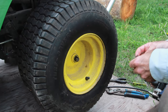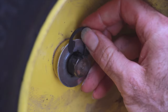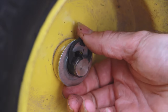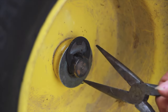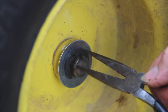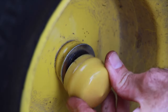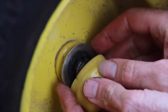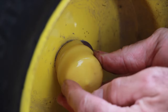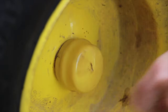Back on the front side of the tire, we need to put the washer back on and seat the C-clip. There's a little groove — the clip should be in front of the washer. Place it in, then your needle nose pliers might work to close it, or you can use channel locks or other pliers. There we go, it's in place. Now put the dust cap back on — just get it placed on one side and then pucker it in the center and work it in.